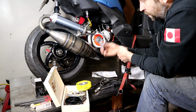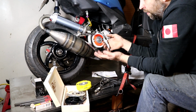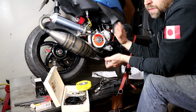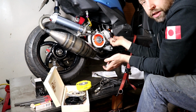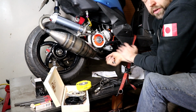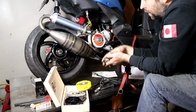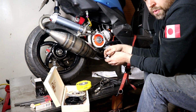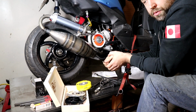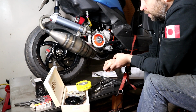You can't use a piston stop to check that the timing is right because you can't run the motor with a piston stop in it. However, with a timing light you can, and so if you know what degrees their curve is set their baseline to, you can then take the timing light and check it and make sure that your base timing is in the right spot. But I'll try covering all that stuff in the next video. We'll go over it all and I'll show you the curve working and how to figure that out. A few different posts and pictures of some graphs and stuff. And yeah, hopefully we'll come at it with a little more knowledge to stroke timing.